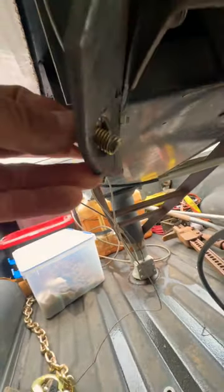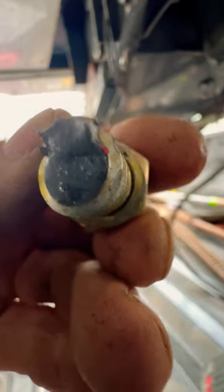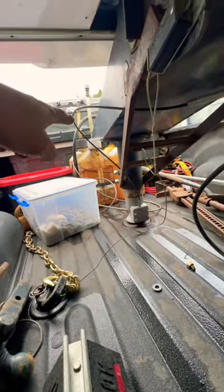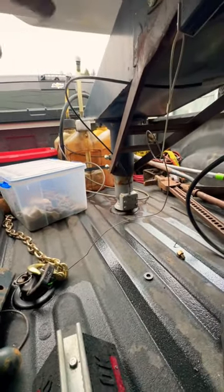Super quick tip on safety chains: if you're hooking up your grade-8 bolts back here to a hole, try to remember that it has a long way to pivot if you 90 the trailer. It snapped these suckers right off — grade eights popped them like popcorn. You should have your safety chain hookup probably right at the base where the mount is and closer to that side, so it has less room to swivel.